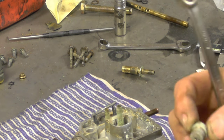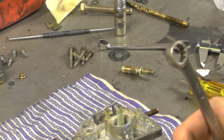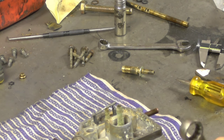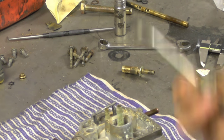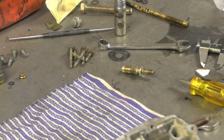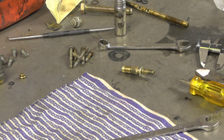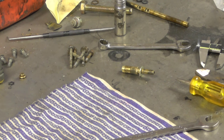And there you go — one little aluminium washer on the back. You can save those aluminium washers because they can be reused a number of occasions — you can simply anneal them again. That one's a bit flaky though, so I don't think it'll seal well. We get one in the kit anyway. Fundamentally we've got all these bits out now — full of grime, dirt all over my cloth from what's come out of the float chamber. Every single piece of that has got to be removed — we don't want any contamination whatsoever in there.